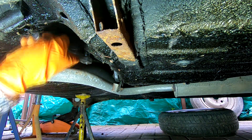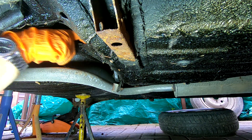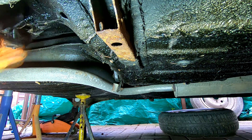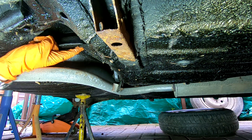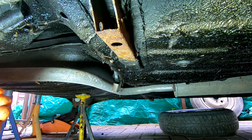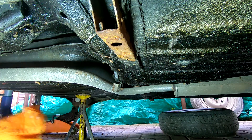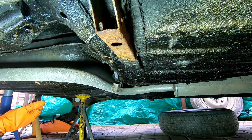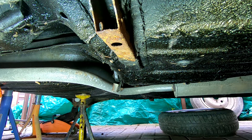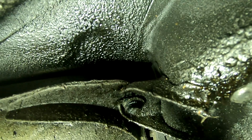I don't know whether Dave was talking about these front ones being slotted. These ones are slotted — you slide the tank this way and then backwards. So that's what he was talking about. Let me go around the other side and undo the other one, then we'll slot the tank out and drop it down. I know there's going to be a sender cable on top. Hopefully you can see where it's slotted — the tank comes this way and then back.